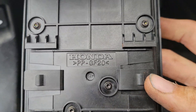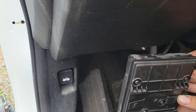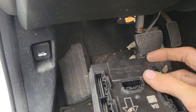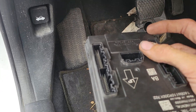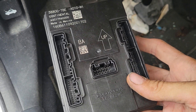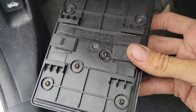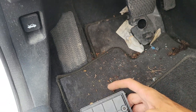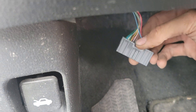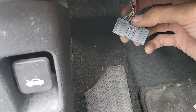Press on this tab and the module will slide sideways to release from the bracket it sits in. But you'll have wiring up there, so you'll want to unplug that stuff first before you attempt to slide it out. Otherwise you'll be working against yourself trying to unplug it while it's loose and flapping around. So unplug as many of the plugs as you can, then press on that little mounting tab and slide the module sideways. It'll drop down a good ways, and then you'll be able to take out the larger plug. There's a trigger on the top of it in order to remove it.